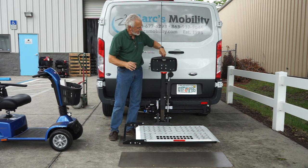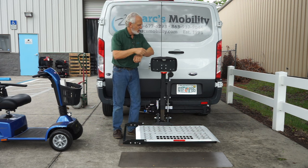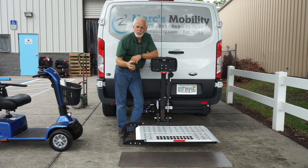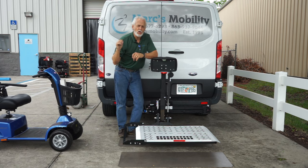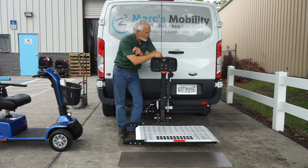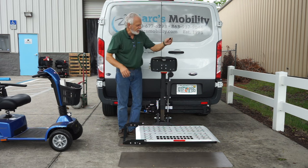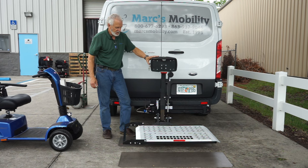On top of this lift there's a little plastic cap. If you take that cap off, you can see my finger going in there. With a 3/8 socket, you can crank this lift manually or with a drill — a 3/8 drill, 3/8 socket. If you ever have a problem — your car battery is dead or the lift motor is bad, which is rare, since these lifts usually last 10 years — you can crank it manually. Just make sure the keys are turned off in the lift so there's no resistance in the motor, and you're ready to go.